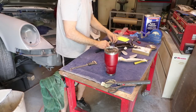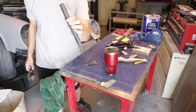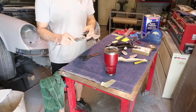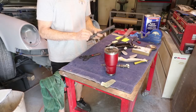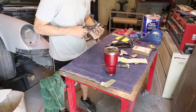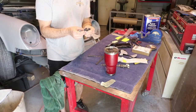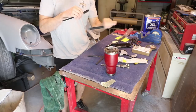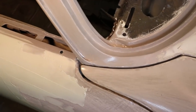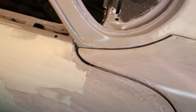I did find some material laying around — this is some heavy-duty shrink sleeve tube, and it measures 1.1 millimeters. So for the purpose of getting the bodywork done, I'm going to cut this and use it in between the body and the fender to get the positioning right, so I don't destroy my semi-good seals during the sanding. Hopefully you can see there's a little piece of rubber in between there. I feel better about it — the gaps haven't changed too much.